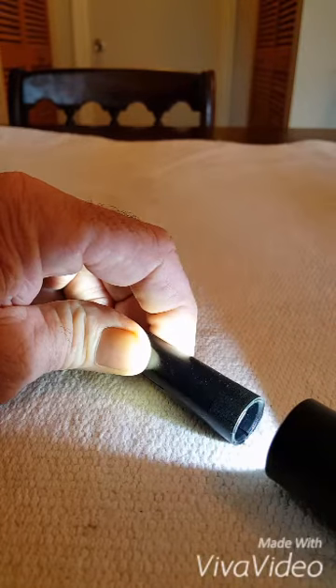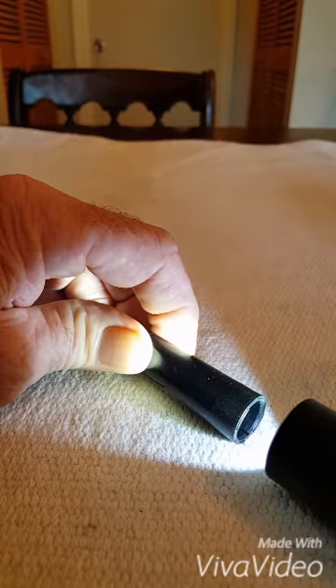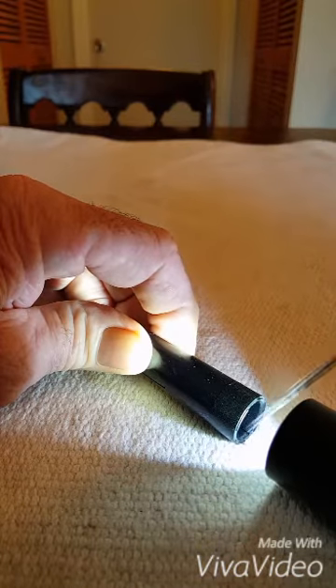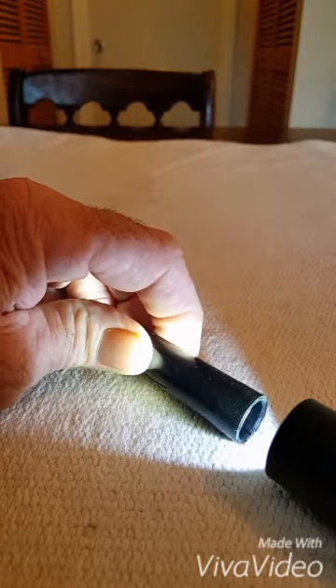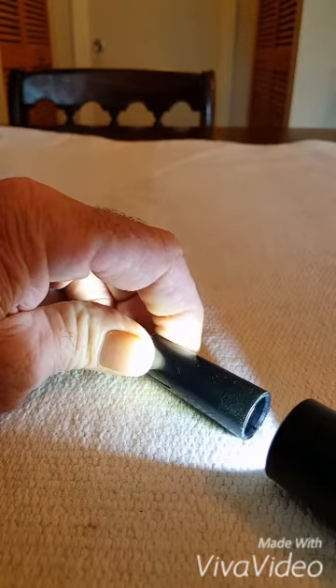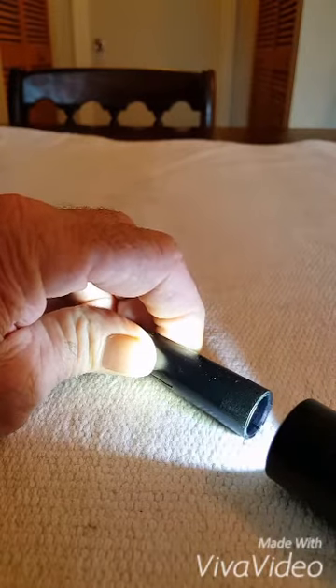All of the air that comes in the wand has to pass through that notch. So if we can obstruct that notch, we'll have no air coming through the tube and we can manually put just the right amount of air in and make our microfoam for latte art.